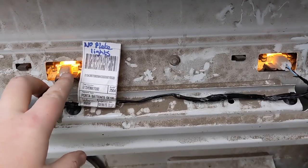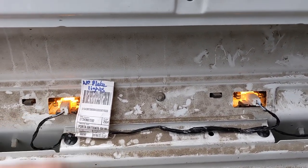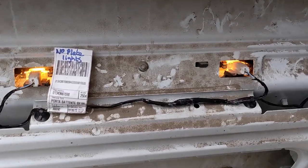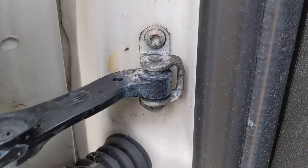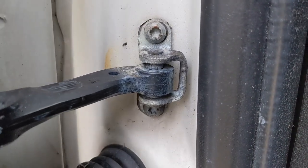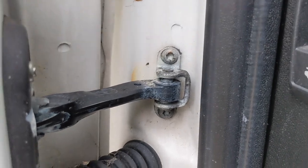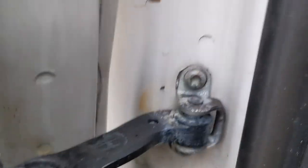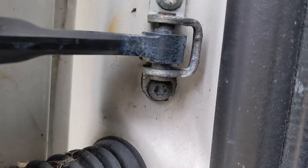I also just did a quick test with these just to make sure they were lighting up — you can get pulled over. It is illegal to drive at night without your number plate lit up, so please just make sure that if you replace these, you check afterwards that it is lighting up, which I can see from this side it is. I also noticed here — it's like little jobs like this. Look at the passenger door — these obviously need to be tightened up. It's just the little things like that, and as you start doing jobs here and there, you start noticing other little things. My advice is if you see anything like that, just get it sorted straight away. If it's a quick fix, don't leave it hanging around. That rubbing there is a recipe for rust. It's going to need a spray of ACF-50 or something like that. I might even take that off and give it a bit of Hammerite.